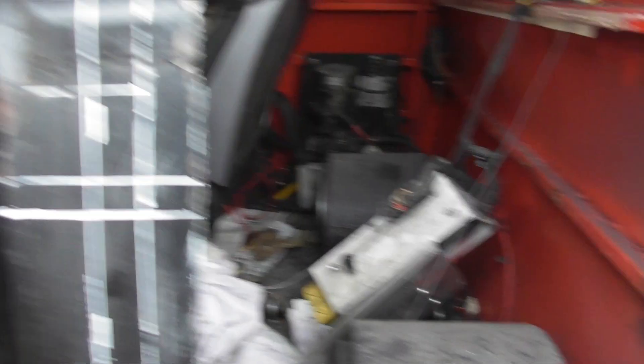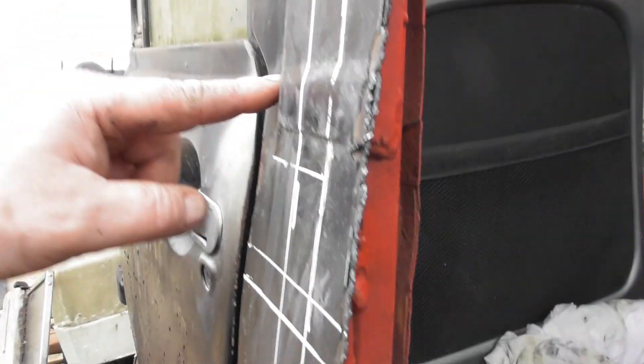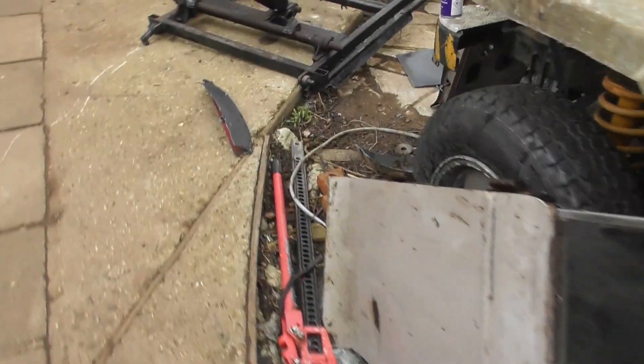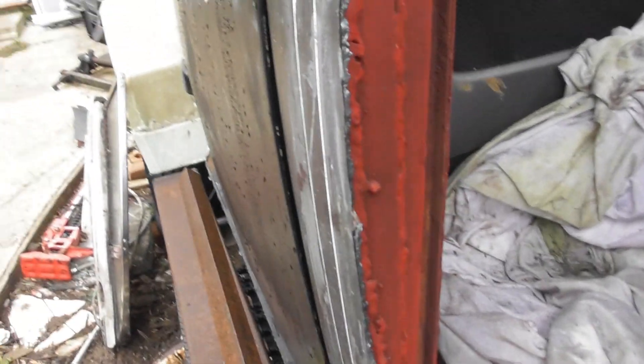I've put a second mark in here that represents the line inside. We've got a bit of a problem - it's why I put it together - because I never intended for doors, and I added this little piece here because I didn't follow the shape on the inside of this structure, and I don't want to cut that out. So what I might do - the hinges are on here. There's an insert there; I'd have to cut a hole out top and bottom to sink those hinges in, then recut this line. So instead, because it's not possible to do it with the plasma cutter - well, I can, but I don't want to - I want to weld these hinges in place. A lot of modern cars do have hinges welded to the doorpost and you have to unbolt them from the car itself, so there's no big deal involved in this.